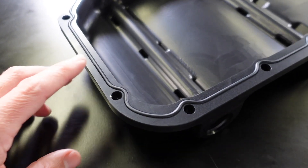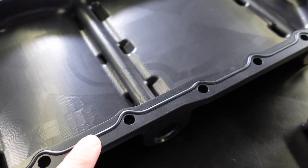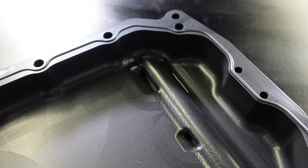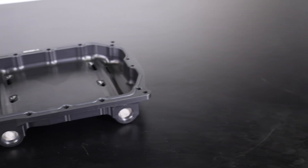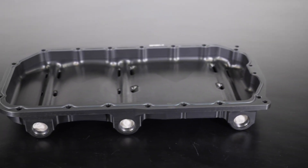A couple of other features with the sump: as we can see here, there's an o-ring groove machined into the sump where it contacts the engine block. This means that we don't need to use sealant to seal the sump to the block. Particularly with a race engine, they tend to come apart for inspections and freshen-ups relatively often, so this just makes the job a little bit easier for the engine builder — you don't need to break that seal and then reseal it again. That o-ring is reusable.